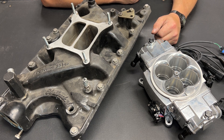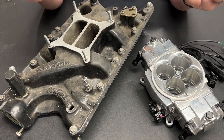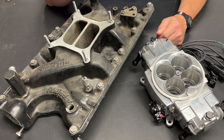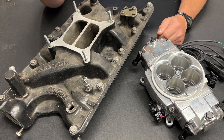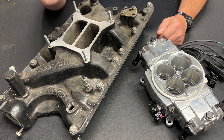I have a feeling it would be like trying to drink a beverage through a coffee straw — just sucking and missing a lot of high-end power. I'd be willing to bet that this motor would outflow that 5.0 upper at somewhere around 3,000 RPM. I refuse to let my motor be strangled above 3,000 RPM. That's why the 5.0 upper on the 351 truck lower won't work for this 393 build.